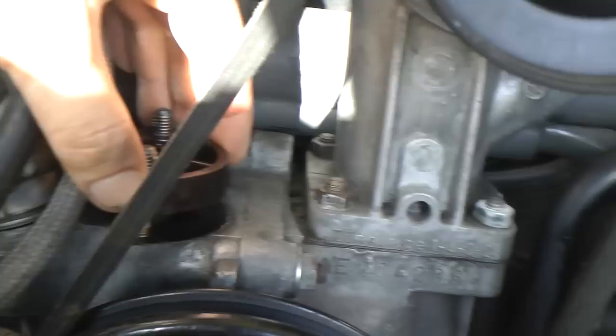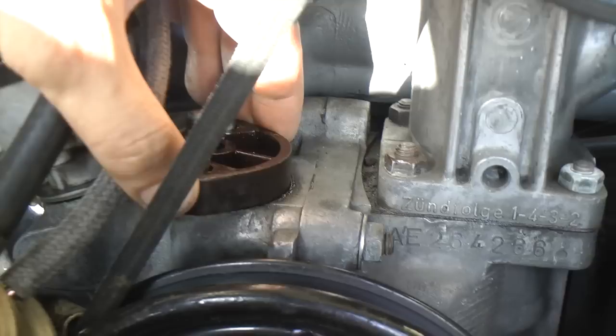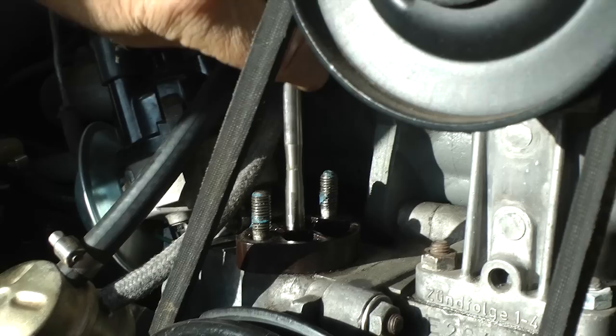One of the reasons for this could be because of your fuel pump. What I want you to do is take off your fuel pump and see the fuel pump stand that I have here. You want to make sure when you raise this fuel pump that it flops down to the block just like this.